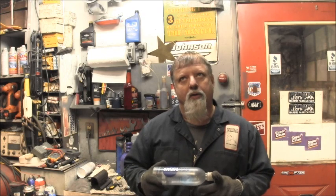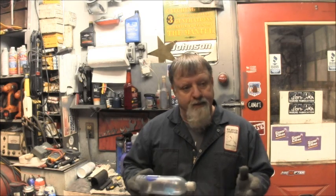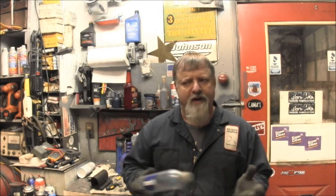Well, I really can't say I've tried this whole conversion from earlier models to later models. But I know I did a 90s one time. It was like a 92. And I put electric start, charge system, recoil. But I used a single dog recoil starter on it. And it worked fine, if I remember right. It might have had a little bit more take up than you would want. But being that it was electric start, it was a backup recoil starting system anyway.